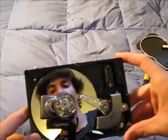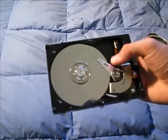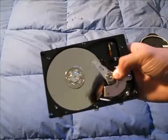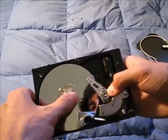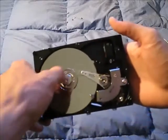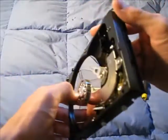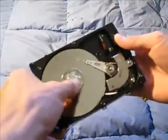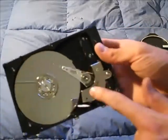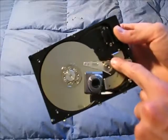Look, it's a perfect mirror — they're shiny. They are made out of either silicate, pretty much glass or porcelain, or metal if they're older. This is an 80-gig drive so I'm guessing it's metal. Here's the actuator arm. This thing spins at 7,200 RPM, which is really fast, and then the actuator arm just bounces around finding the data. This is only one platter, so that means there's 40 gigs on the top and 40 gigs on the bottom.